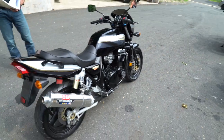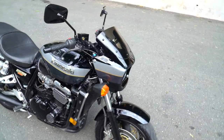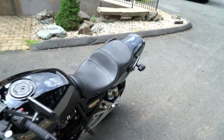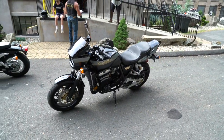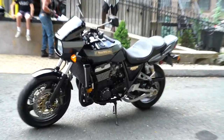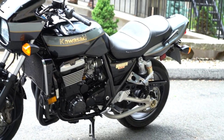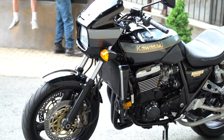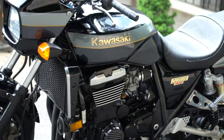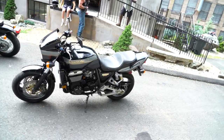I've got the title in hand and the owner's manual. The ZRX 1100 was made from '99 to 2001. It's a four-stroke transverse four-cylinder double overhead cam with four valves per cylinder, displacement of 64.2 cubic inches or 1,052cc. It looks like an air-cooled bike but it's liquid-cooled. It has a bank of 36-millimeter Mikuni carburetors, jetted for the full Yoshimura exhaust. CDI ignition, electric start, 106 horsepower at 8,700 RPM, with 72 foot-pounds of torque at 7,000 RPM, five-speed transmission with chain rear drive.